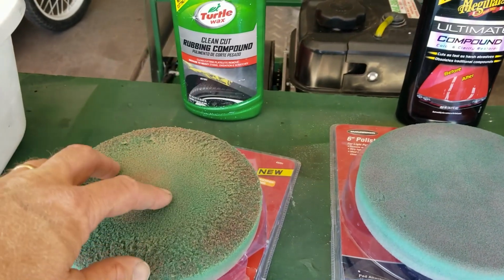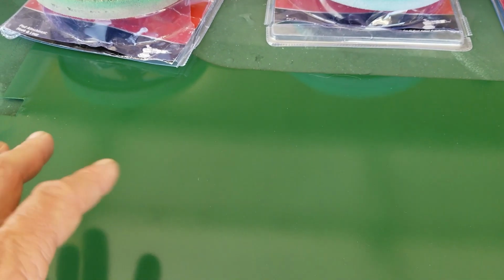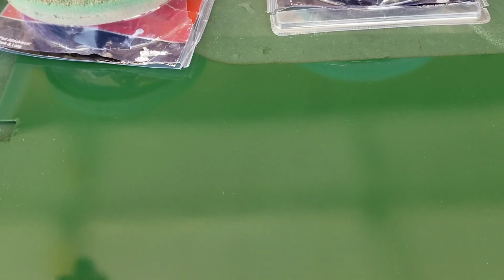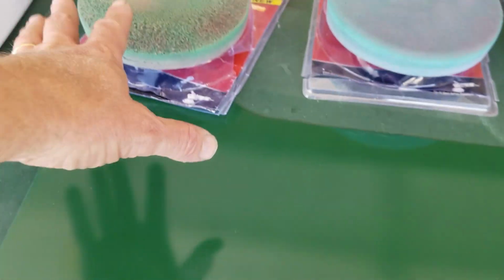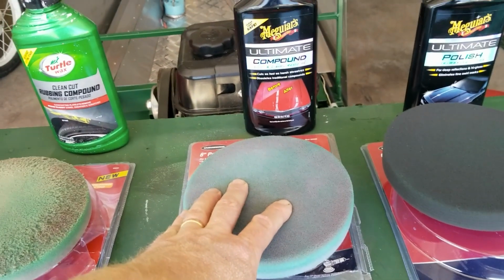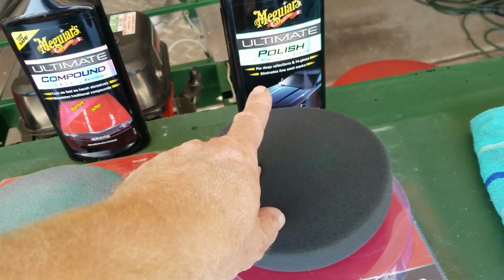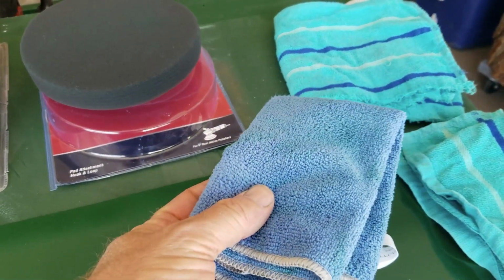As I'm using these, I'll be wiping them clean with a damp rag, because it leaves this milky cream on the surface. We wipe it down, I remove all that buffing compound and the paint, I guess it's inside the buffing compound. Wipe it off and start each pass with a clean piece of metal, so there's no old compound on here each time I add more compound. I'll go through the entire panel with this one and that rubbing compound. Then I'll clean it and switch to this next one. Again, I'm going to be wiping the surface down, cleaning it in between passes, and I'll take probably 2 or 3 passes with each of these. And the final polishing phase, this one tells you polish it until it starts to dry, and then stop polishing and wipe it clean with a microfiber rag. So I've got one of those here.